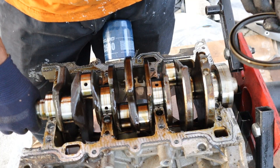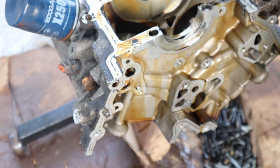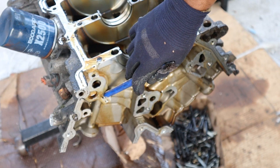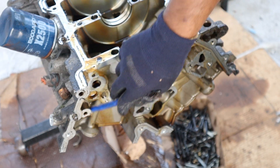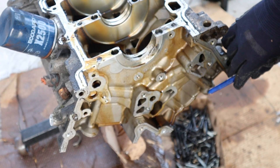This is the rear main seal by the way — nice heavy piece. Here's where the oil will come from and how it gets lubricated. Splitting off of that main gallery, we've got one that goes to the head over here, then some going to chain tensioner one, chain tensioner two, and another one going to the other head.